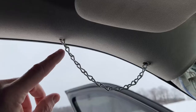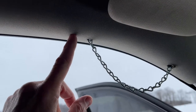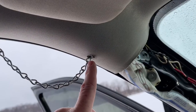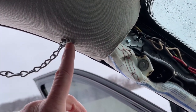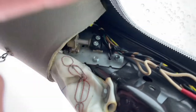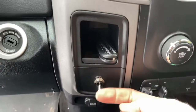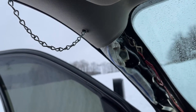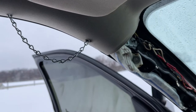The chain runs through a hole drilled through the headliner. Right here, one end is bolted to the main pillar so it's not going anywhere. The other side goes behind the liner with a small wire tying the chain link to the pull switch, which sends power to the solenoid to activate the horns. Right here is also my on/off switch for the compressor, so I don't always have it running — I just turn it on when I need more air.